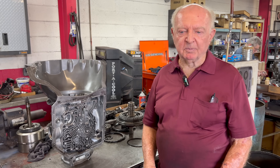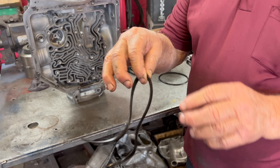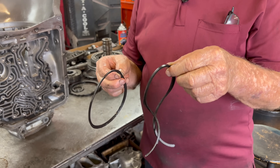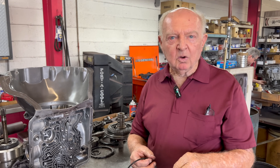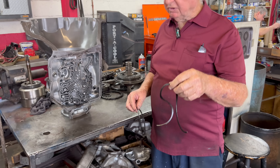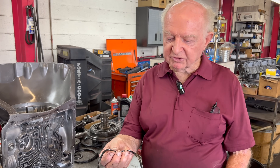Because of the stop leak, it was difficult to get apart — it usually just slides apart. It attacked the seal, and the seal looks like a rubber worm. It should be nice and stiff, but this is really different. Whatever this stop leak is, it attacked the seal and ruined it — balled it up and expanded it so much it won't shift. The seal is like putting two seals in one groove. It softened it up and expanded it where it can't work.